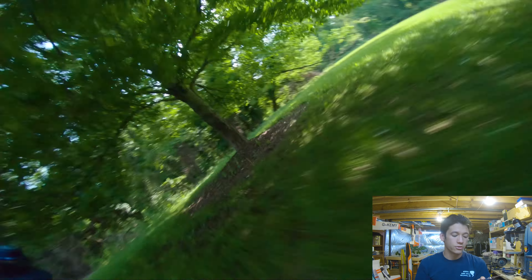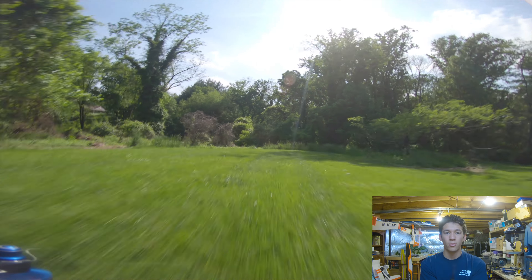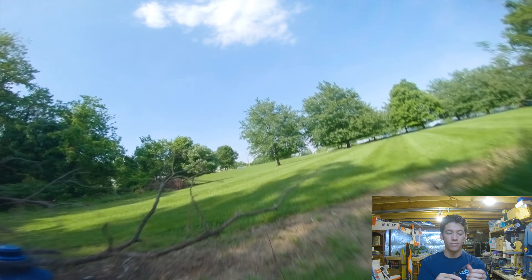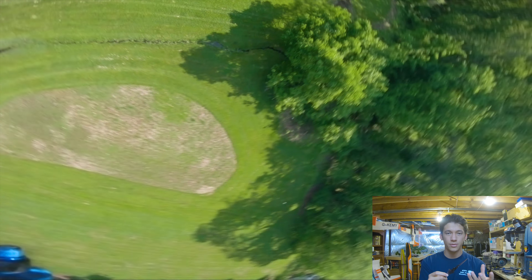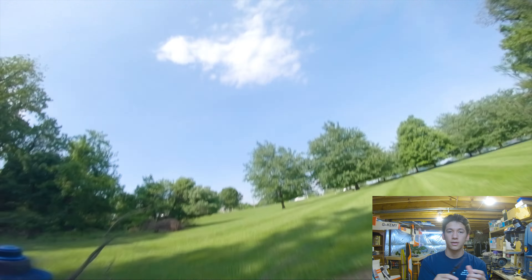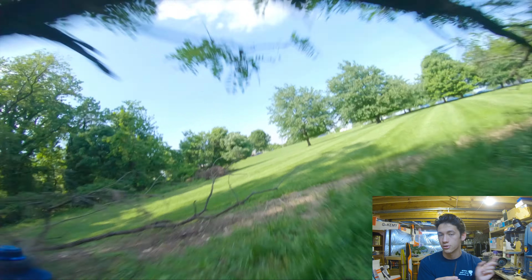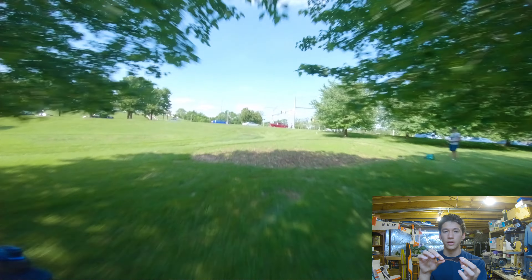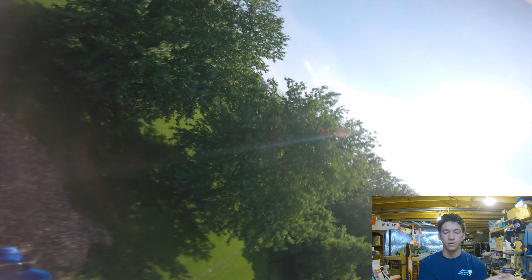That led me to try the E-Max prop, which I'd had laying around for a while but never tried because the Gemfan was so good. I was very surprised at how this prop felt — it solved all the control feel problems for me. It has a kind of wispy feel which I like, and it revs higher even at idle. I think that's because of how it all tapers — the weight is in the middle and the blade tapers so the motors can spool it up into the high revs much easier.